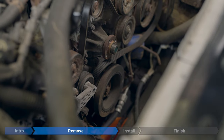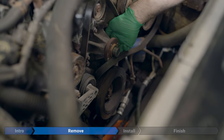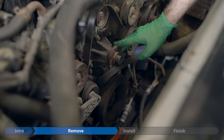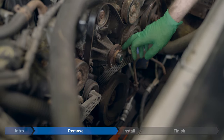To get the water pump off, we're going to remove four more 10mm bolts — one, two, three, and then one just underneath on the back. Before we take this off, put down a bucket or some sort of drip tray, tarps, cardboard, whatever. There's going to be some coolant here that will spill out, and we just don't want to get it on the floor.